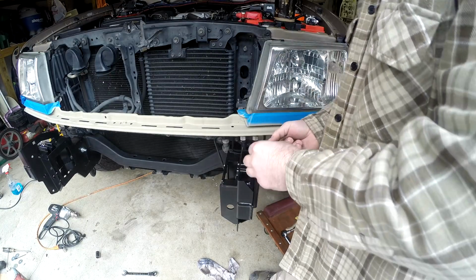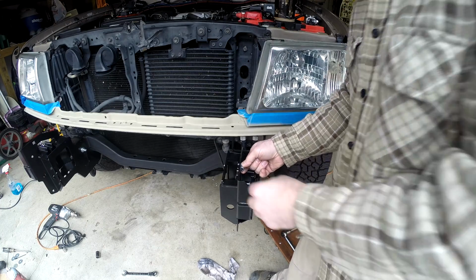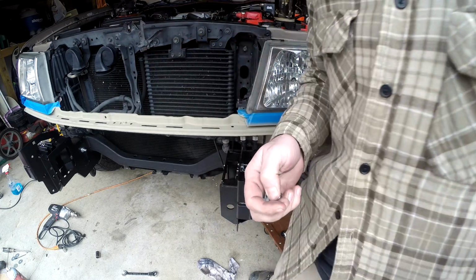Measuring correct, tighten all bolts securely. Fit 10 millimeter cage bolt. Four main bolts on each side of the bumper hold it to the brackets. Two of those are bolts going through the cage nuts. Initially, you're gonna tighten those just to get the bumper in the position that you want. And then once you have it exactly where you want it on both sides, you'll drill two holes on each side, and those are called the pinning holes, and you also have bolts through those holes.